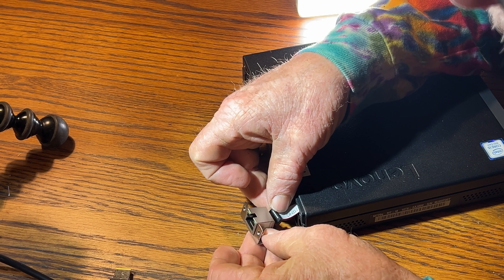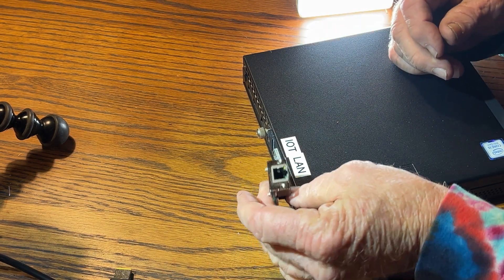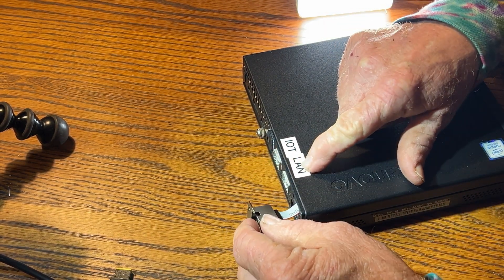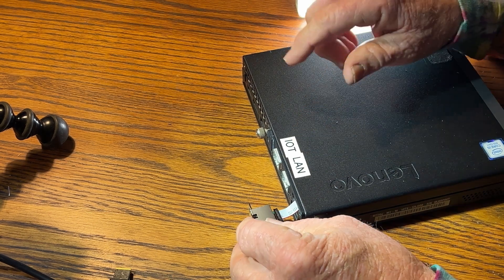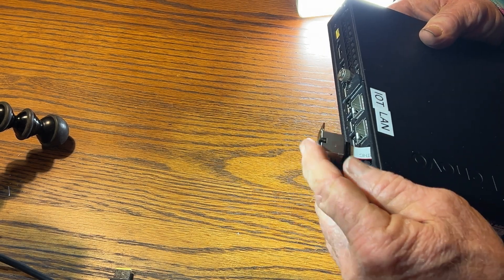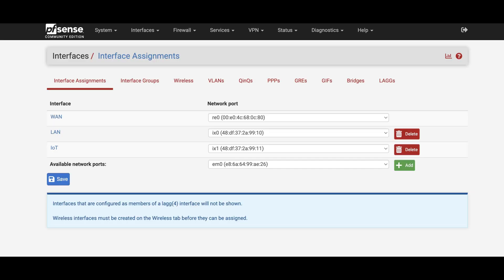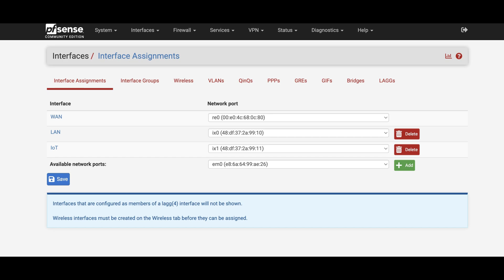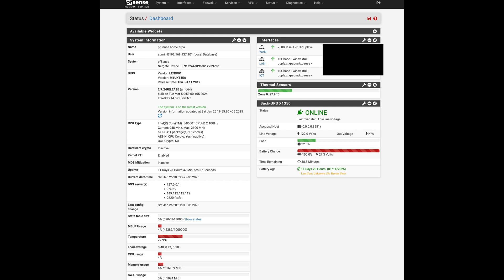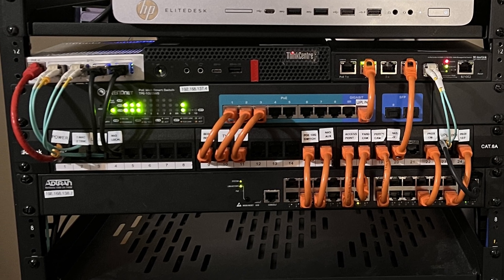We're going to put it back in the rack and install pfSense on it. I'll have my 2.5 gig WAN port, my regular LAN, and my IoT LAN. Here are the four network interfaces in pfSense — I currently don't use the 1 gig interface, but you can see the 2.5 gig WAN interface and the two 10 gig LAN interfaces that I use. If you made it this far, thanks for watching — stick around as I dig deeper into this home lab journey.